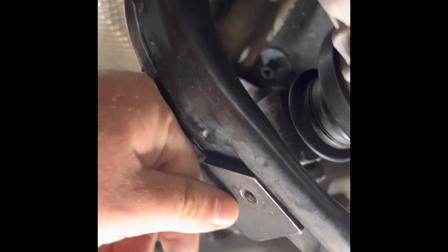We're ready for the install. I'm going to be installing my personal shield — this is the revision for the drive shaft shield. Slide it right in there working with one hand. This factory hole here is going to line up, and this hole here is going to line up as well. It will be a square hole and a straight hole to the heat shield. Once they all align, the drive shaft itself will be in the middle of the shield — that will be your bottom piece.